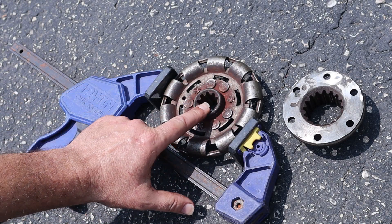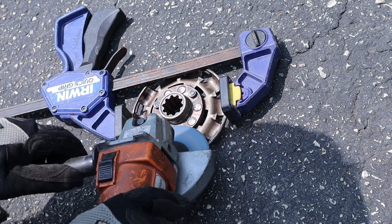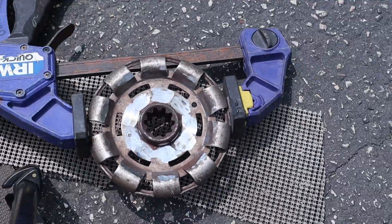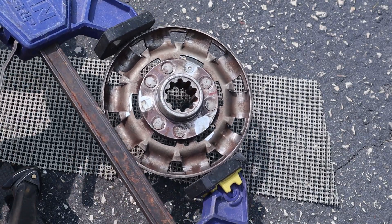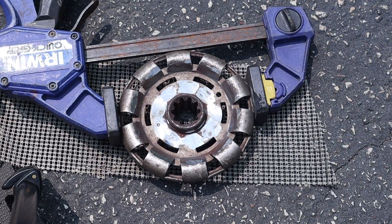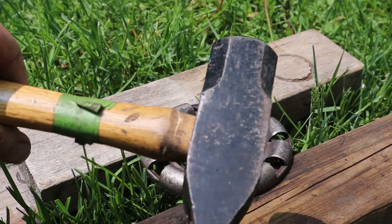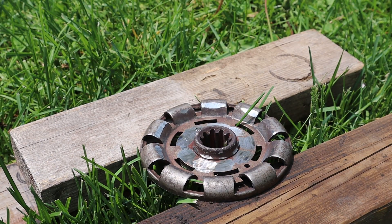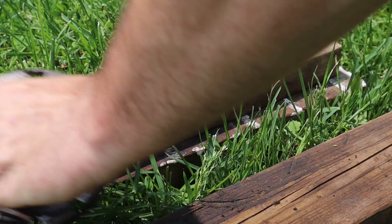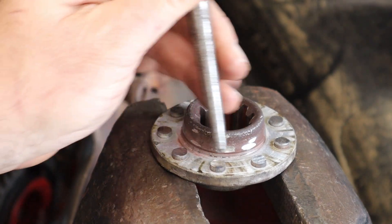I am going to grind out these rivets to get just that center bit out from the clutch. So I got all the rivets and everything ground off, but it's also been my experience that it's still pretty much impossible to drive out those pins. What is required now is some brute force. We can try this hammer, but I bet we have to go to the big one right away anyways. Let's give it a whack, see what happens. Hey, look at that! Now I should be able to drive out what's left of these rivets.